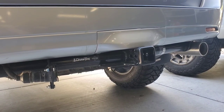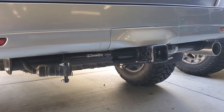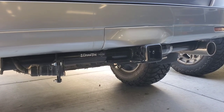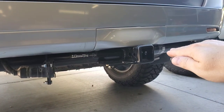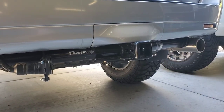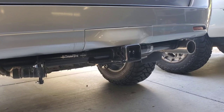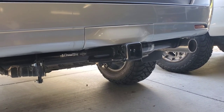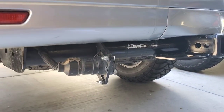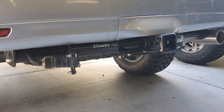I want a frame-mount tow hitch if you're serious about towing. What I run — you can see it here — is a Draw-Tite, current production, that I put on recently. The Draw-Tite is rated for 6,000 pounds or 600 pounds tongue weight. Tongue weight is the weight pressing down on the ball when a trailer sits on it. There's also a frame-mount option from Curt rated at 5,000 pounds and 500 pounds tongue weight, so why not just go with the Draw-Tite? It also has a nice steel bracket welded on it that accommodates your factory seven-way. That's my recommendation — use the Draw-Tite and you'll be in good shape.